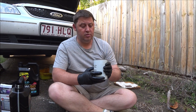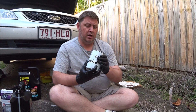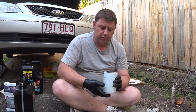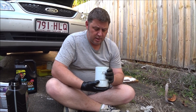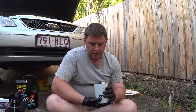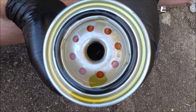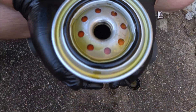Now I'm going to show you how much comes out in a second, because what's happening is the oil is being absorbed by the filter medium. There's a paper filter inside these — that's all they are, just a paper filter with a metal casing. If I look in here now, and you look in there — I don't know if the light's any good — you can see there's no oil in there. It's completely empty. So by pre-filling it, we're soaking the filter medium with oil.